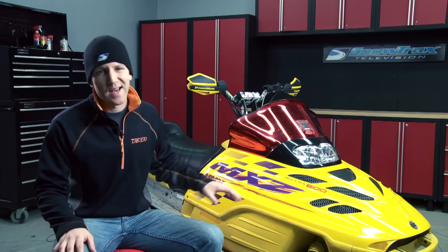While there are lots of updates you can do to your old sled, most won't net you any kind of performance advantage over your stock setup. But installing an MBRP exhaust canister will give you a reduction in weight and an increase in performance, and in my books there's just no downside to that equation.